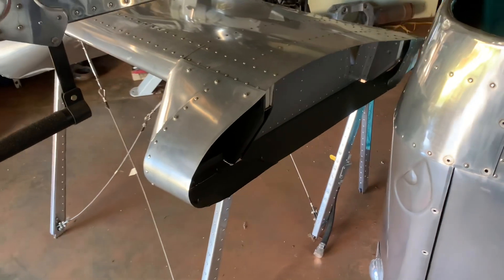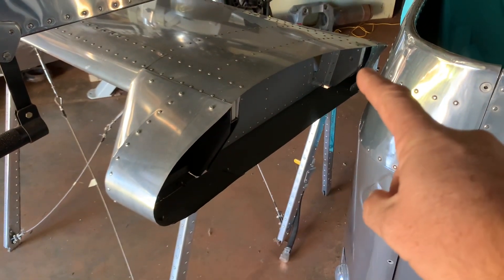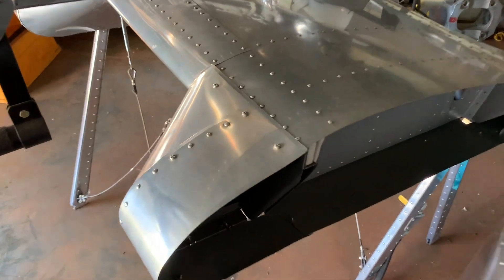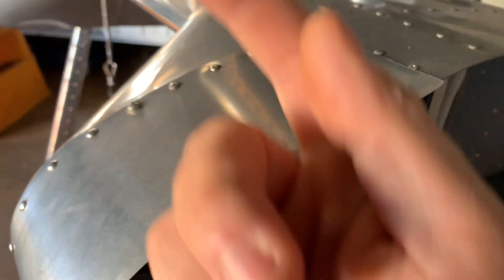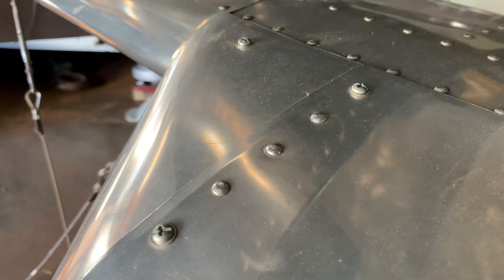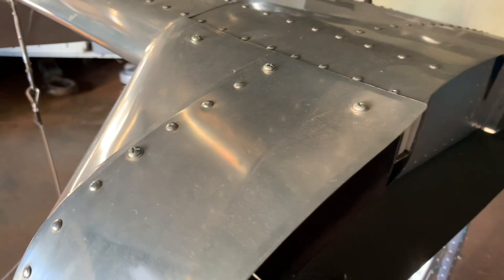There's another example of thinking outside the box. This is my wing center section that bolts on above the cockpit area - there are the wing attach points. This whole piece here is a fairing that's screwed on because I needed access to the bolts. They're screwed onto a little rib inside. To have these two pieces riveted together and attached, I needed the countersunk screws facing out. These are actually the rivet tails, just like on the trailing edge of the rudder and elevators - just to mess with people's minds, because it's cool and a challenge. Lots of little quirky things like this all over Frankenstein.